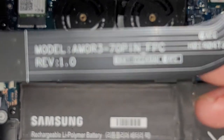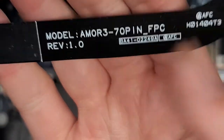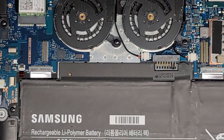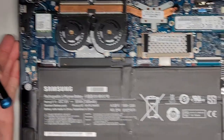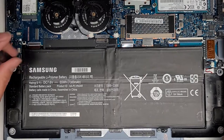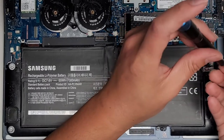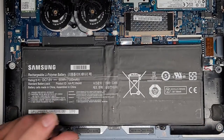Make sure you don't damage this. If you do, there is a model number on the bottom if you need that. Make sure you plug it back the same way — the sub goes over here to this board and the main goes to the main or motherboard. Now the battery has a few screws — only four screws. So we're going to remove those four screws and then pop the battery out. Hopefully the replacement battery we got is correct because I had to go based off just the model number of the laptop, and they kind of use a generic thing.